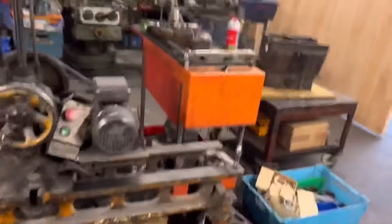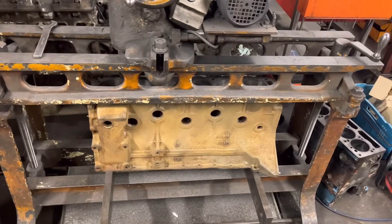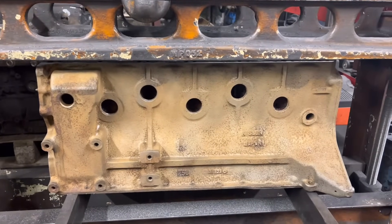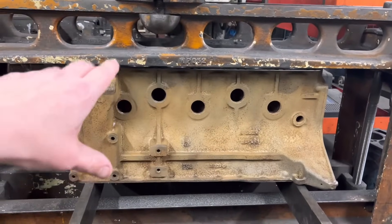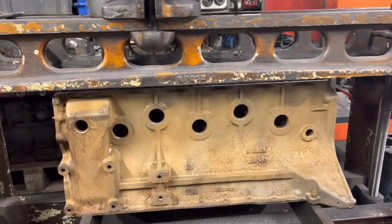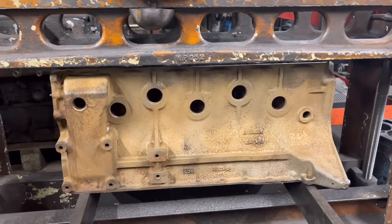That's nearly all we've got time for guys. I've just finished boring Wayne Greatrix's block — you can see that is a lovely bronzy colour because it's been sandblasted and now we've got to clean it up. We've removed the core plug. It's been bored, and before I hone it I'm going to put it in our vapour blaster and give it a good blast, get that rust off. Then I'm going to finish hone it and that block is pretty much done. But that's it until Friday's video — have a lovely evening, we'll see you then. Thanks guys.